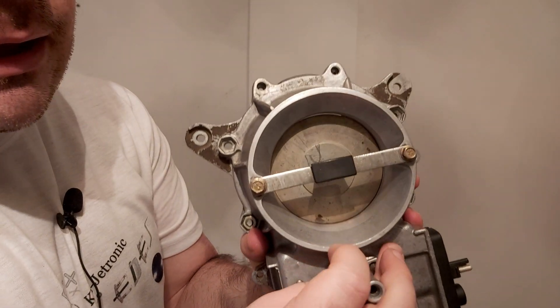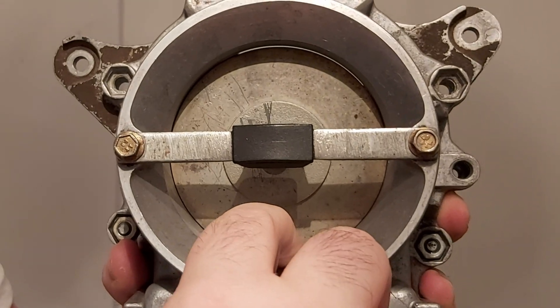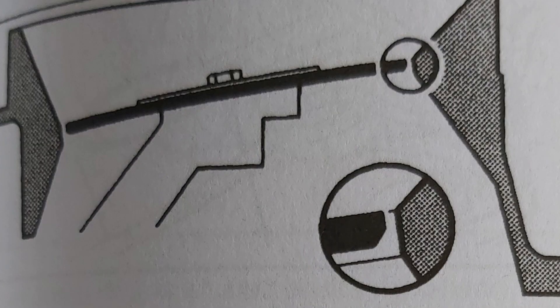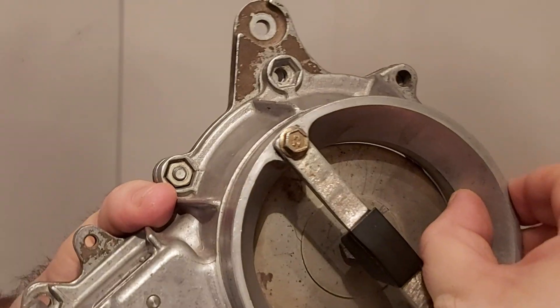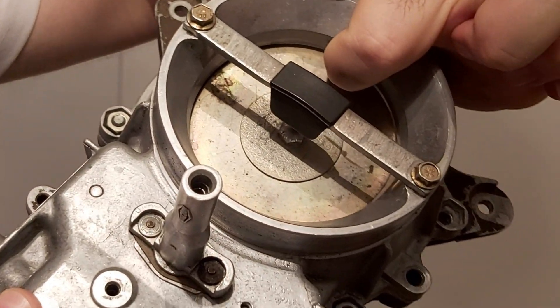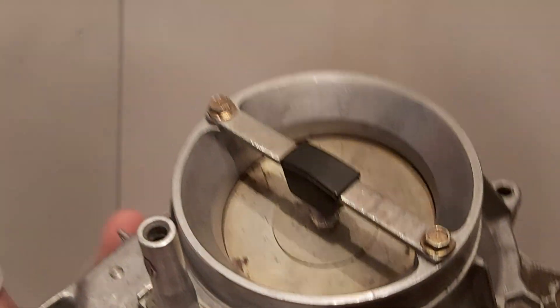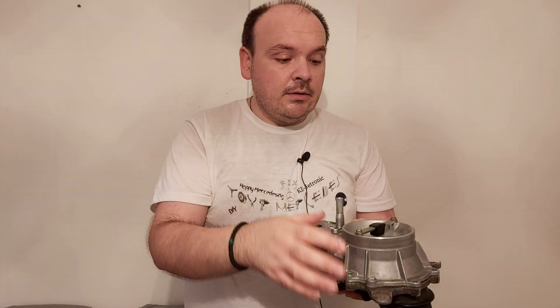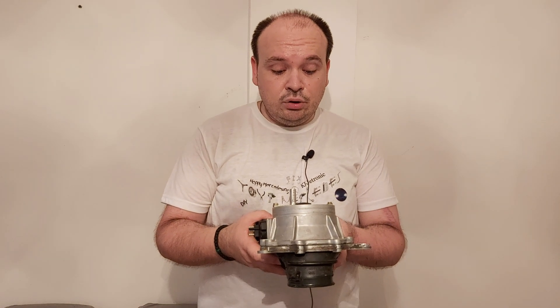Let me show you — the sensor plate should come right up to here, approximately. If you see where my nail is, that's how much above it should go. If you experience any detonations, it will go up. The more it goes up or down, you'll get vacuum leaks, so it's not good.